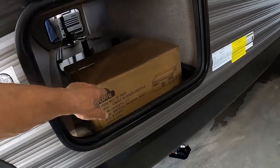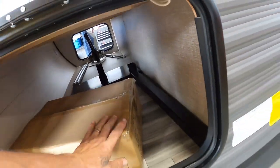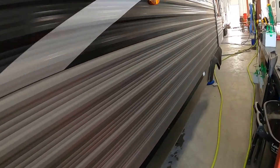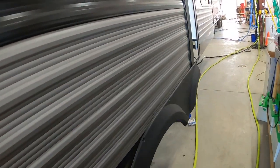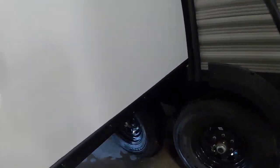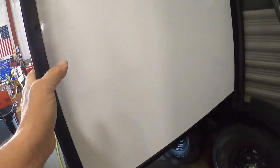There's a big pass-through storage area here with a griddle, a J-port arm, and table — I'll show you where those hook up. On your slides you have side seals with a lubricant you can buy to spray on a couple of times a year to keep them from dry rotting and keep them nice and flexible. That's really important. We also have an extra gray tank full up underneath there — we'll talk about that when we're leaving.